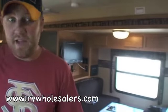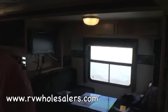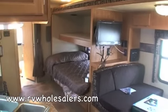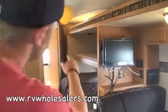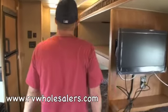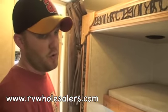When you want to bring it in, you just hold the button in — it'll then run the slide room from the bottom up and then in first. You want to make sure that anything that's in the way, like the table in the back, anything on the floor is off the floor and out of the way so that when we bring it in, it does not catch on anything. One big thing about your unit is you have a curtain back there. You're going to want to make sure that someone tucks this behind here when you run it in, otherwise you're going to tear it off the wall.